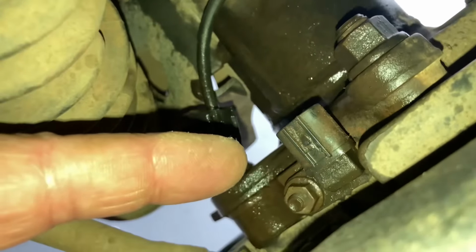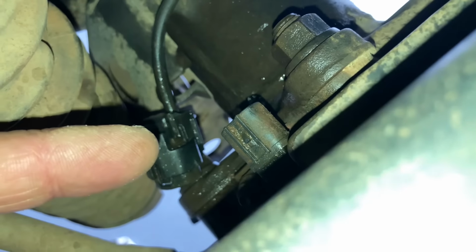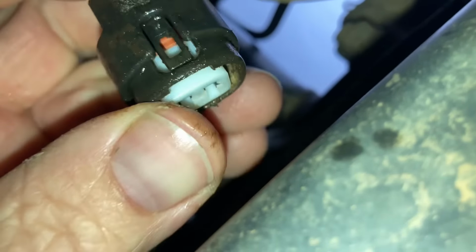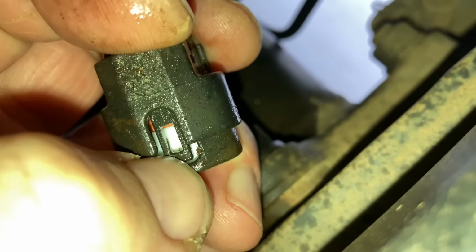These plugs can be quite tight, so we used a lot of compressed air to clean it. Then we sprayed Inox on there. They were still fiddly, so because they're a bit older, you normally just press on this back tab here from memory. But it wasn't doing a lot. So you've got this little tab in the middle there. See that piece right in the middle there at the end of my finger? Just get a little pick and get under it and lift it up.